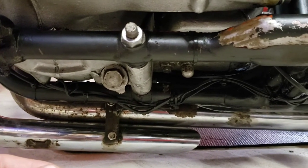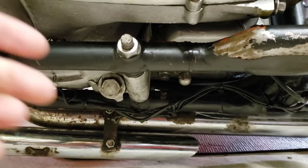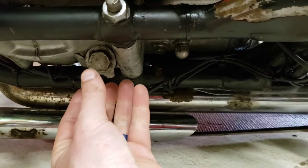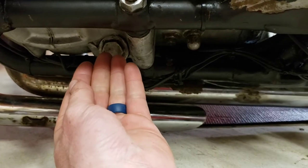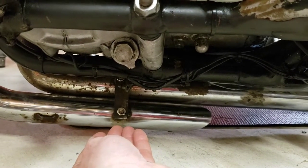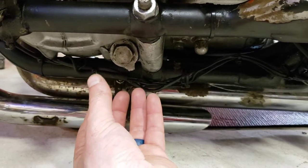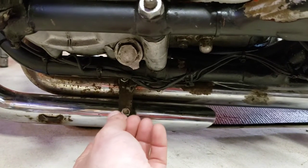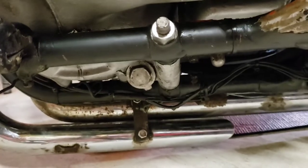If you have an oil-in-frame bike, you're going to remove the oil cap from the top of the frame. This won't be a bolt — it's going to be a metal plate with four bolts in it. You're going to remove those four bolts; it's going to have a flat filter, and all the oil is going to drain from there. Same for your pre-unit construction, where your engine and transmission are separate — it's going to have a plate with a filter in the plate, and that's how you remove the oil left in the motor. So let's get that bolt out and we'll go from there.